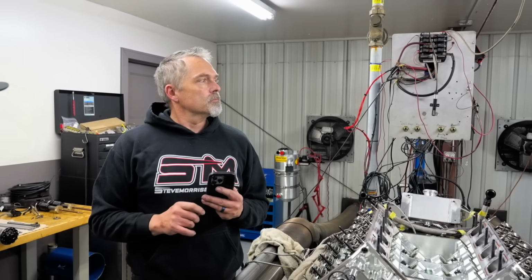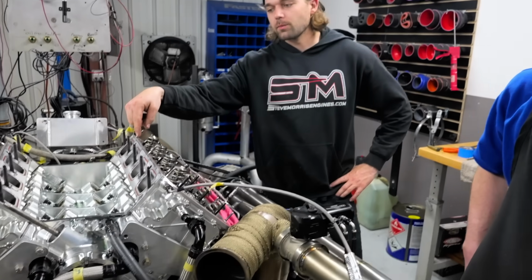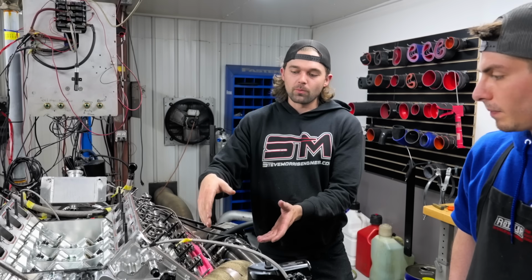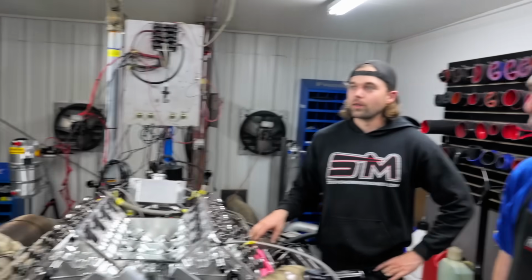Yeah, as far as I know, the pump mounts exactly like how this pump mounts, right off the side of the block, and is driven by the cam sync / distributor. So it's technically a wet / dry sump because it's an external Billy Bad Boy billet pump. It just doesn't have a tank, it's picking up off the pan. So it's not doing anything other than going in a straight line.